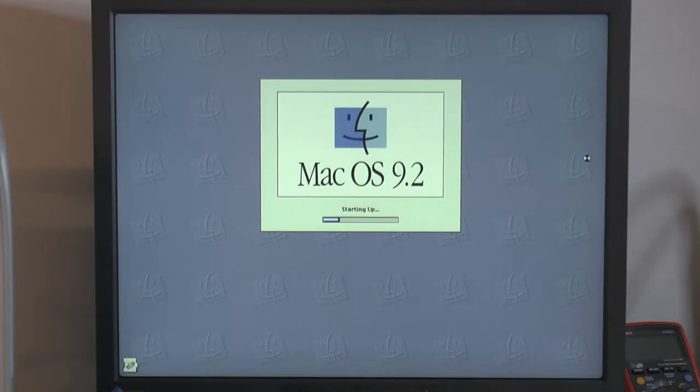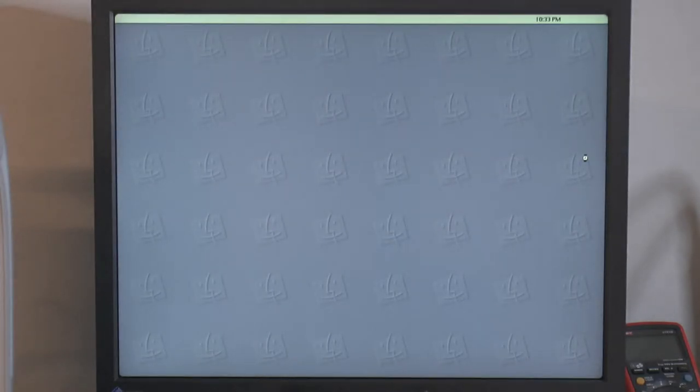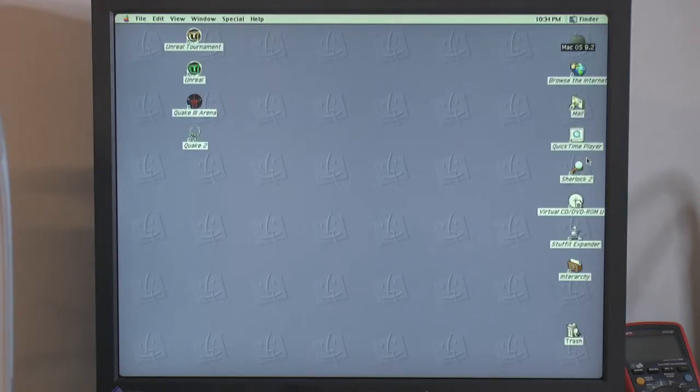I have run Geekbench on it, and it gives me around 400 points, which is about 20 less than the 732 MHz version of the CPU in the Quicksilver. So that kind of makes sense with the fact that we have about 75% of the bus speed now. So we're losing the equivalent of like 100 MHz from the CPU natural performance. So it's not fast, but it's roughly where I think it should be compared to a lot of Geekbench scores, and it seems to line up.